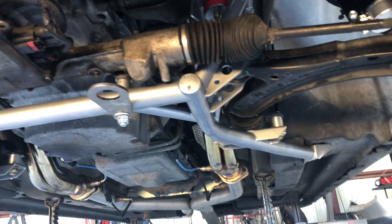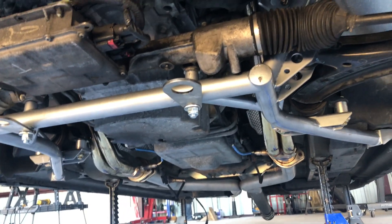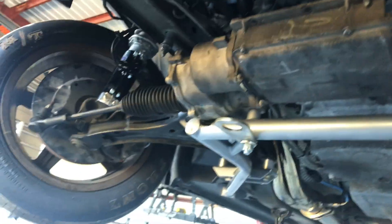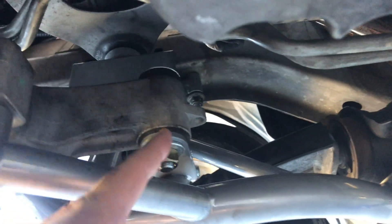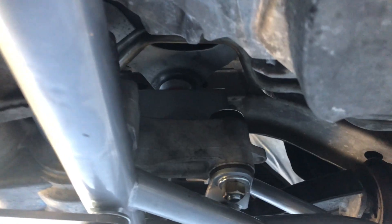Check it out — not bad. It really wasn't too bad of an install. The hardest part was just getting everything lined up together at the same time. One thing about the steering rack: it has this backside bolt back here. On the 11-to-14 car, since we have the electric power steering, there is a spacer that has to go in there — you cannot put it on in the car, it needs to be put on in a press, which luckily we have. So we just popped it back out, put it on the press, pressed the spacer in so the bolt would fit correctly, and then we were good to go. It's all buttoned up down here — looks pretty good. We just threw the wheels back on hand-tight. Now onto the front so we can finish our intake install for our race ported S197 intake. We're still going to use the stock air box with our Air Raid tube and our AFE filter.